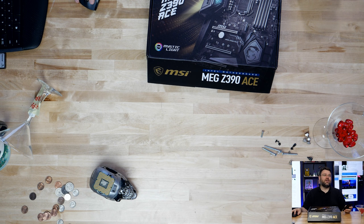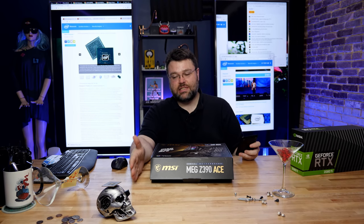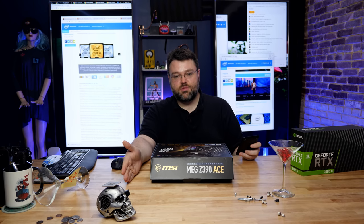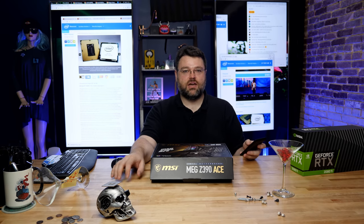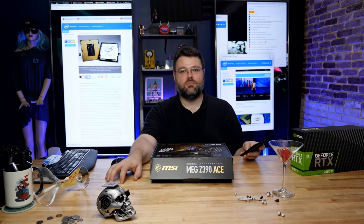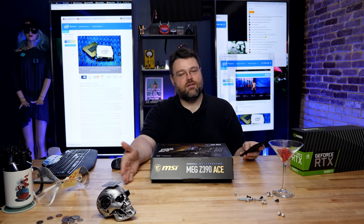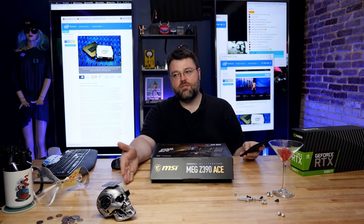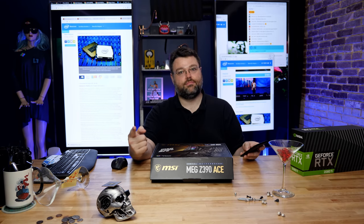16 megs of cache, it is unlocked, up to 40 PCI Express lanes. Again, that's what I got off on a tangent on, the 40 PCI Express lanes. It's 16 plus 4, it's just the plus 4 comes with a MUX that will let you run a bunch. So you have 16 plus 4 PCI Express lanes worth of bandwidth across the platform. It's just that those four, it's like a PLX bridge, but you're never going to get more than, the DMI 3.0 is never going to be more than 4 gigabytes per second, period.